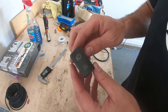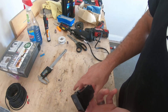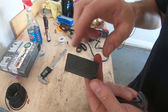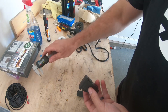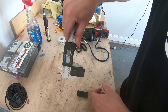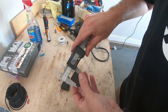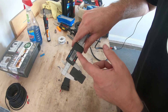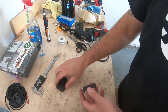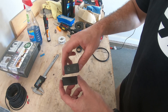Okay, so here's the fog light switch — it's one that kind of mimics what Toyota uses, it's in my Tacoma, so I felt like it was relevant to use for the color of the paint. This is from Greg Parts — the 3D printed parts. I laid some scribe lines on here; essentially what I did was just took a pair of calipers, grabbed an approximate width — let's say 660 — grabbed the width of this — should say 945, 944 — split the difference, and basically just drew scribe lines all around it. Now I'm just going to poke some holes in it and take a Dremel so we can get this to fit nice and centered on here.